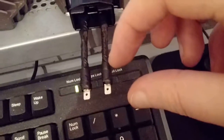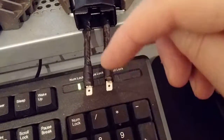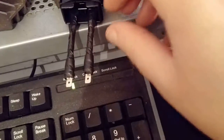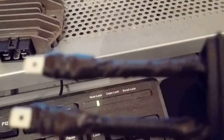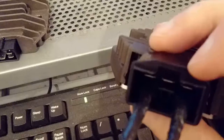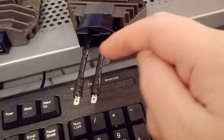One of those two large connections is an earth and the other goes to the starter relay. I'll find out online which is which, then plug those in using the 4.8 mil spade connectors I've crimped on. I've taped everything up quite well because I don't want water getting in, and it's not something you'd need to take apart really. I've left the three standard-size connectors as they are, and I'll just use the wires already on the bike to plug into those.